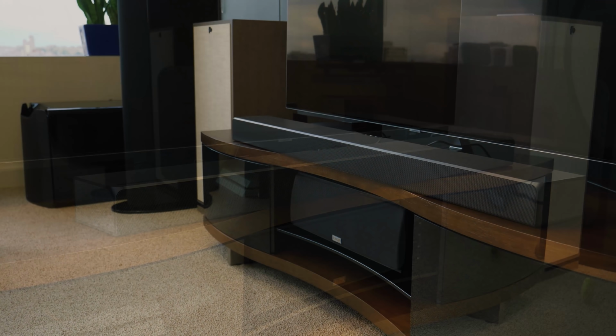Samsung's little cradle stick remote here is once again the way to control the system, and it's pretty easy to control things like volume or subwoofer level on the fly. There's also a smart sound mode that basically automatically adjusts the bar to whatever source you're playing, which is really nice. Tapping the settings key allows you to control all the individual channels, which is important because there's no auto calibration here. So you'll need to control all the channels separately before you get it all tuned in. There's also basic EQ here for treble and bass, so you can adjust that, but if you want to go even deeper, there's a multi-band EQ, which is accessed by holding down the settings key for about 5 seconds.